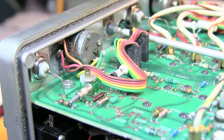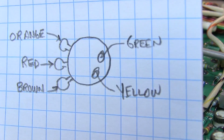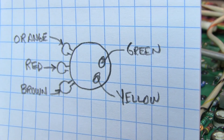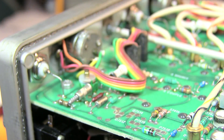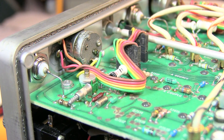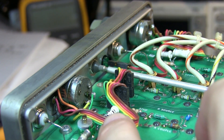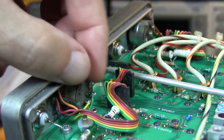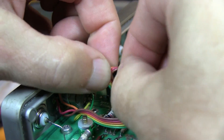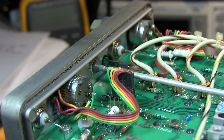Before any desoldering or disassembly, I made a quick diagram of the wires going to the switch and the three wires going to the pot, so we can pull all the wires off the harness and reattach them in the proper order. The wire harness going to the control is on a little terminal strip, so we can simply unplug it and remove everything as an assembly and attach the wires on the new part right on the bench.